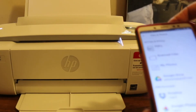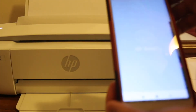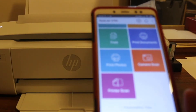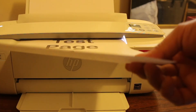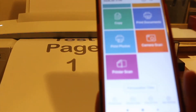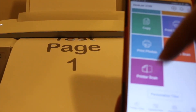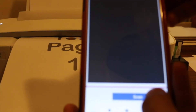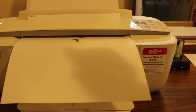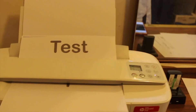To do a scan, place a page on the top scanner — the scanner is just under the handle. In the app you will see the printer scan button. Place the page facing upwards like this. It will catch the page and you simply have to hit the printer scan button in the app, then select the blue button. It will start taking the page itself. If it's not taking the page, it means it is not inserted properly — you have to push it a little bit in.